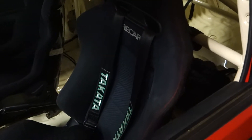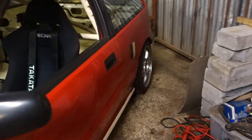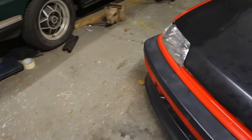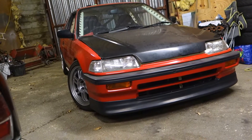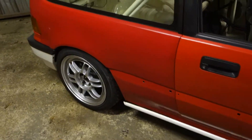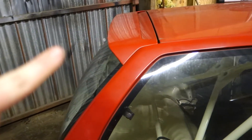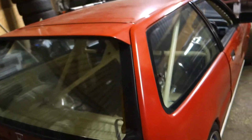We've managed to do a couple of bits to ours as well. The DC5 Recaro is mounted, the harness is just about done, and we've also been messing around with the alignment. The rear has been dropped around 10mm and we're trying to get the toe about straight on the front because we were toeing in massively. The side skirts are all fixed on there now, and our only missing ingredient is going to be the spoiler, which we've ordered from the States.